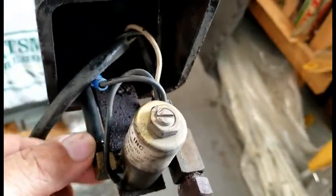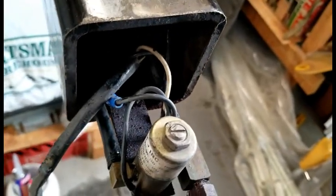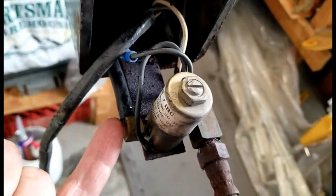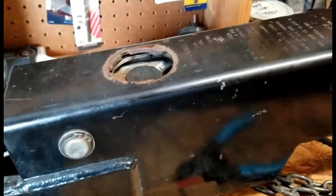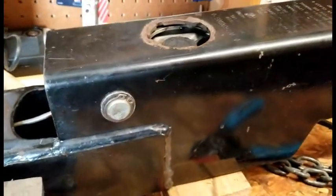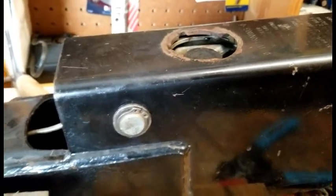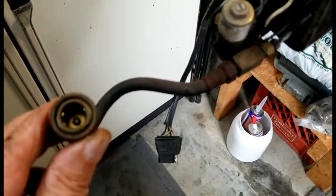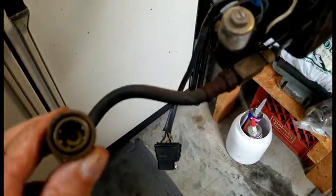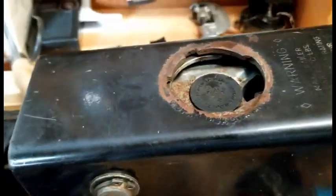If you have the hydraulic line on the back, what I did was put fluid in the master cylinder, then had this off with a cup underneath and just let it bleed out until it started running out of the hose — so I know that hose is filled with brake fluid. It's actually leaking a little bit, so I need to put a tie wrap on there to make that sleeve nice and tight. The only thing left is to do the brake bleed. There's a way to reach through that hole in the bottom and push the brake master cylinder piston backwards so you can pump fluid through it. You can hold it open with a little pin, a piece of nylon, or a little stick to let the pressure off. When the brake fluid comes through, it should not have any more air on the inside. Just make sure you keep filling up the master cylinder with brake fluid — you don't want to introduce more air into the system.